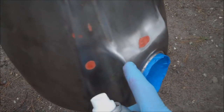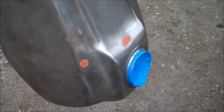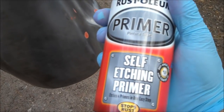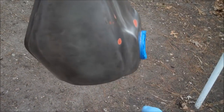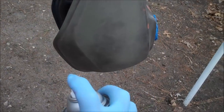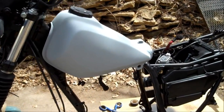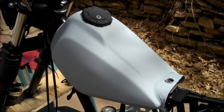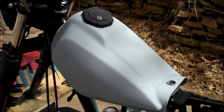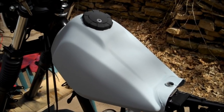I filled in any minor imperfections with putty, sanded the whole thing down with 300 grit, and cleaned it off with acetone. The first layer of primer is self-etching, which goes onto bare metal. I'll top that off with a couple coats of regular primer and sand it down with 300 grit. And I've basically got a fully restored, brand new fuel tank that will last years and years to come — and that is how you do it the right way.